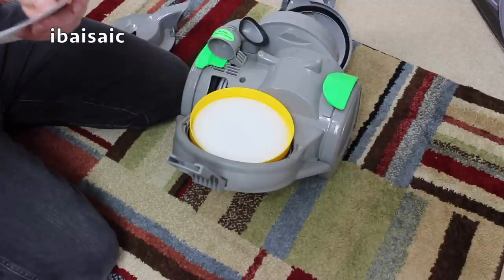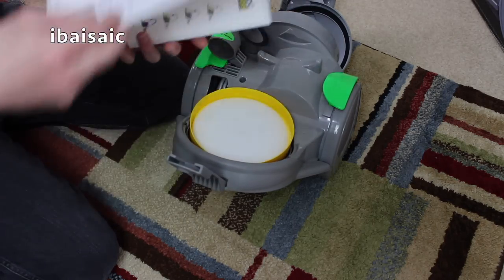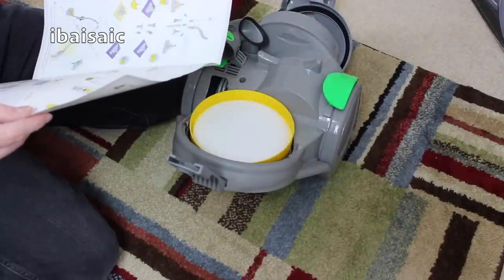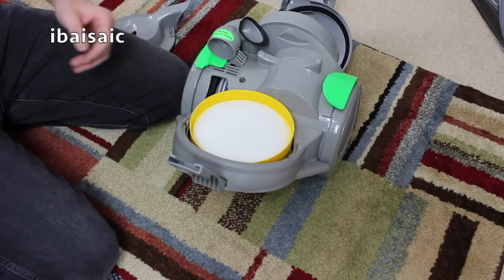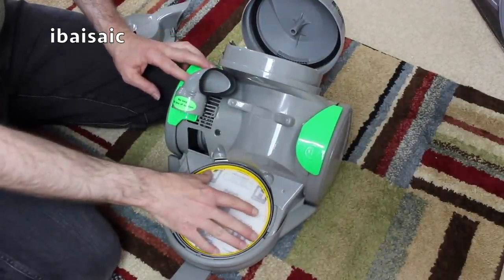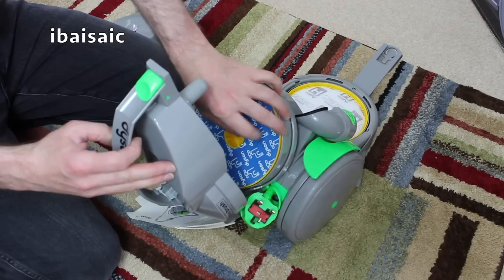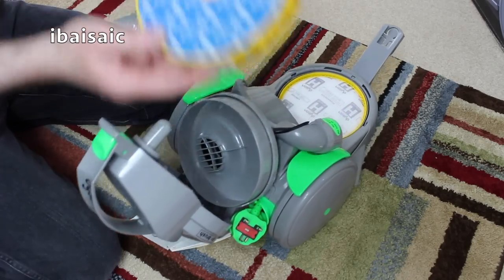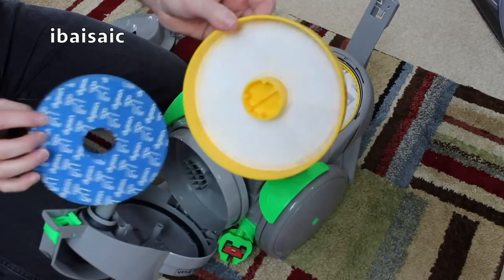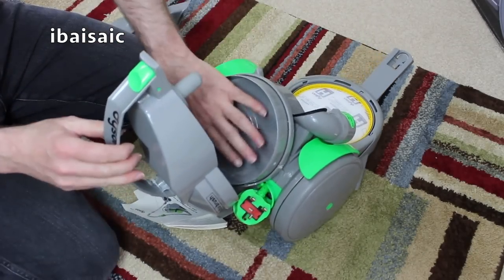The top filter is certainly washable according to the pictures in the instruction book, and I expect the other one isn't meant to be washable. No, it doesn't look like it. So that's a permanent filter there - fits in the bottom with the writing uppermost. And here - this is your exhaust filter, which is washable, hence the tap illustration. That's the foam that comes out, and that's your other filter. You can rinse it under the tap, give it a good clean, dry of course before use, and that fits into the top here.